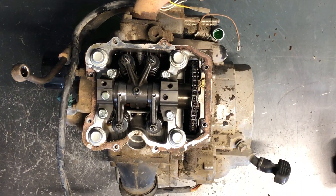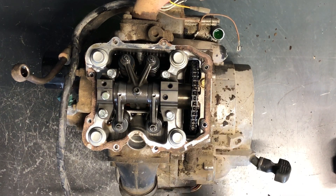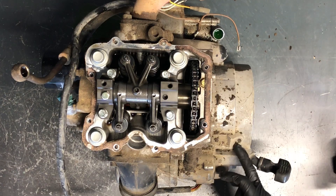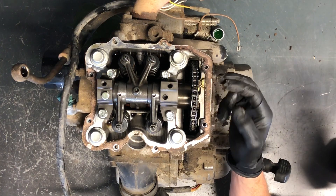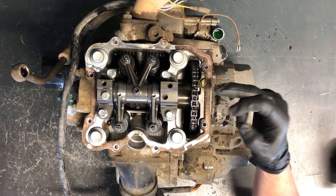On this side we also have a 14mm cap right here, and that's going to let us look down into the flywheel area. On that flywheel you'll see some marks. If you pull this cover, you'll also be able to see there are two dots on the top of this cam sprocket.